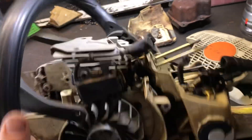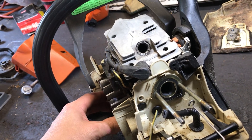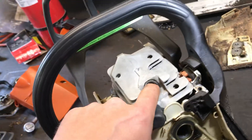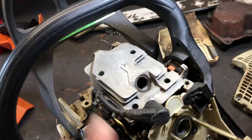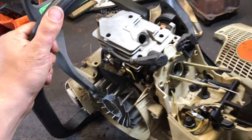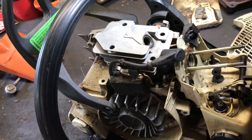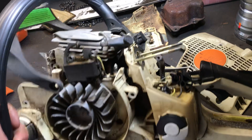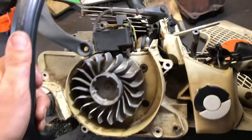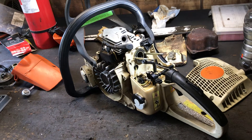Without even diving into this more, I'm going to assume this needs a complete rebuild. It's probably a bearing that came loose out of the cage and got chomped by the piston — got sucked in and shot out. There may even be damage up in the cylinder head. This is going to the junk pile. Lesson learned: check the cylinder first and make sure there's no scoring before you start dumping money into it. I fussed with the carburetor quite a bit and bought a brand new fuel tank vent that I shouldn't have. Live and learn — I hope this helps somebody.